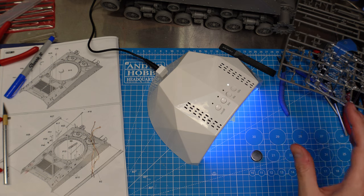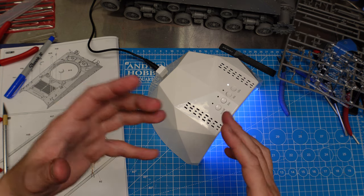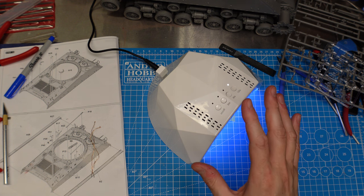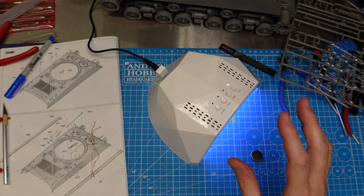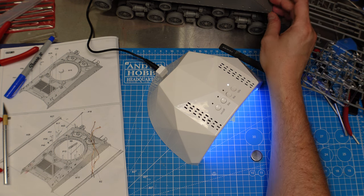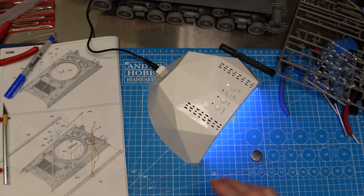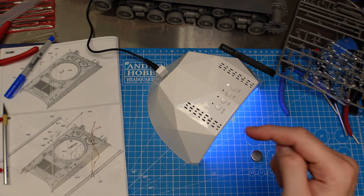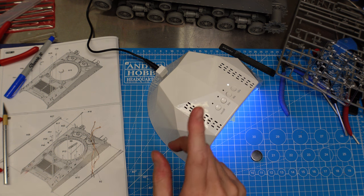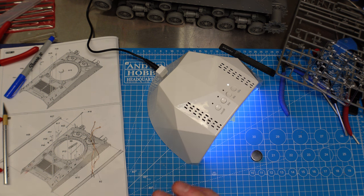And when we come back, we'll have our bulbs and our taillights just like we did for the headlights. Same thing. You do have to be concerned with light blocking. So you'll want to test light all of these things with your finger over the lens, and look for any light shining through plastic or where you've drilled the holes for the wires. And you'll want to block those off from light.